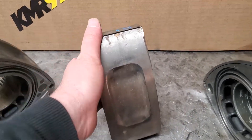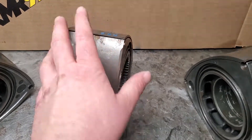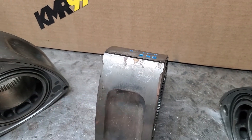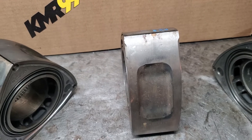That makes a little more sense. However, it was not nearly the change that I think some people expect — it's very, very minimal. There's a lot of talk on the internet about notching, and we tested it at Mazda Tricks and were surprised and enlightened by the fact that we saw no gains when we did the testing.